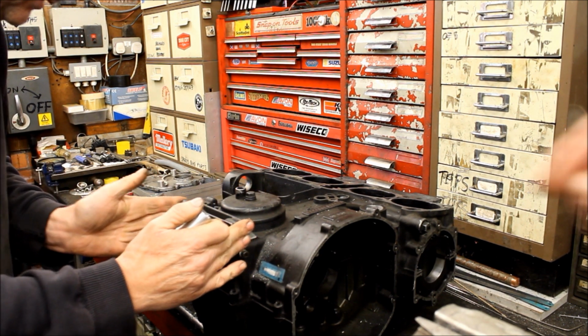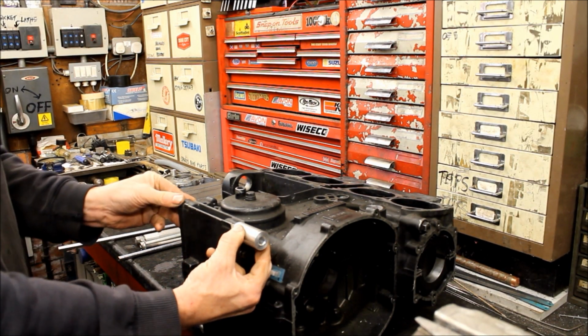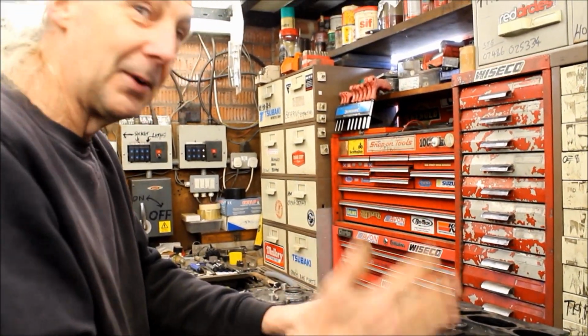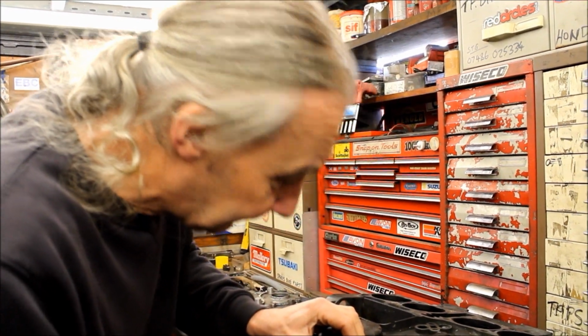So you're now machining this nice and flat. That has now been done on the miller, so that is as flat as you're going to get. Okay. So now everything, when it's bolted through, can sit up nice on flat faces.